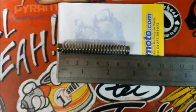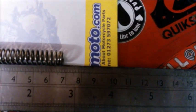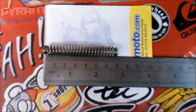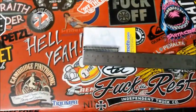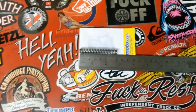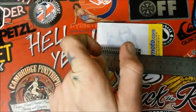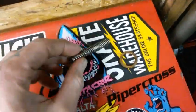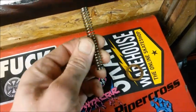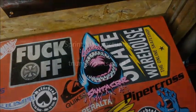I measured up the existing spring as well, which is sitting at approximately 67.5mm. That is much shorter than the spec — was it 73.1mm, I can't remember exactly — but we can see that over the years it has compressed and lost a bit of its spring. Incidentally, if you want to do that yourself, in the UK, Sprint Manufacturing — if you Google them — they sell the replacement parts.